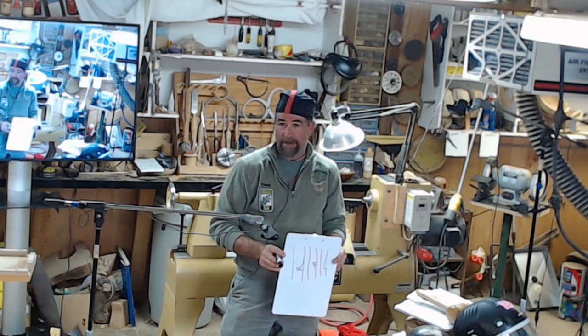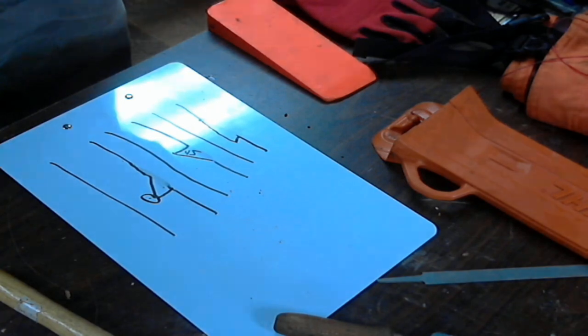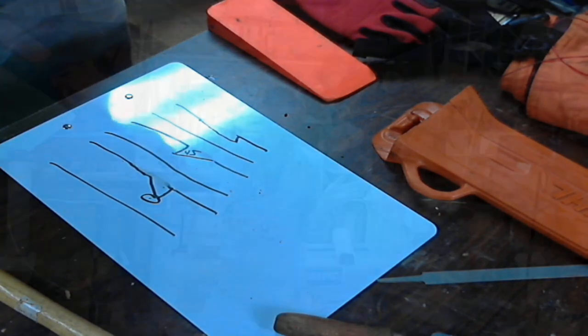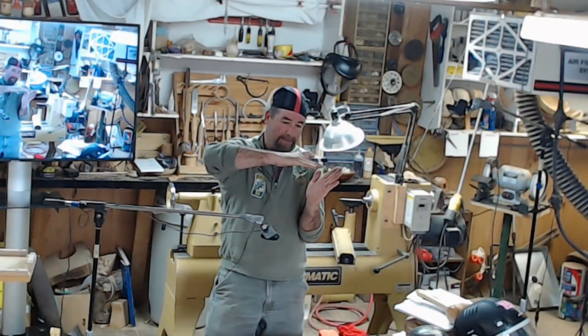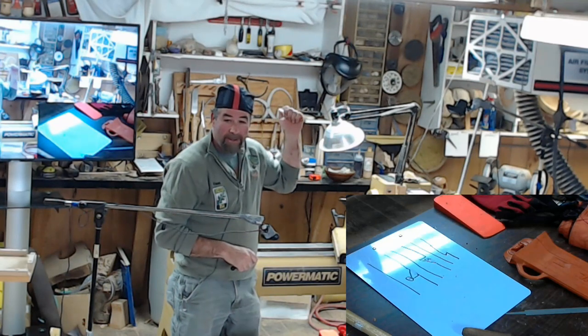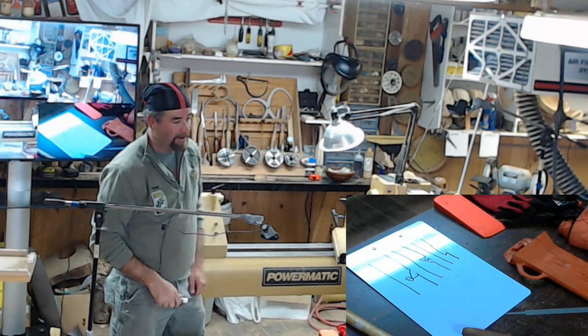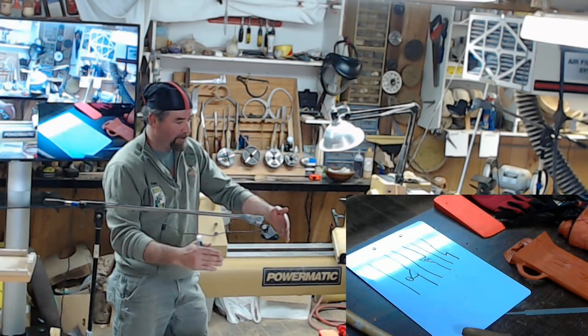That's what you're trying to avoid. Does everybody know what a barber chair is? A barber chair is when the tree starts to go and hits that notch, and the back part of the tree breaks out because it has so much force and pressure in there that it has to go somewhere. So it breaks, and if you're standing behind that tree, it'll throw you into the neighbor's yard while crushing your head at the same time. You always want to stay off to the side of everything, not directly behind or in front of.